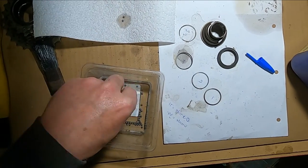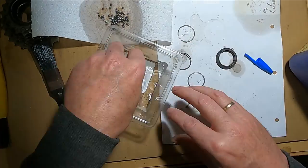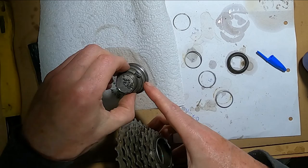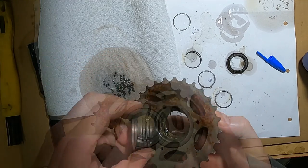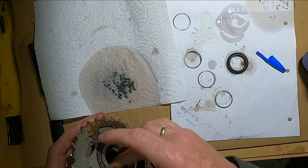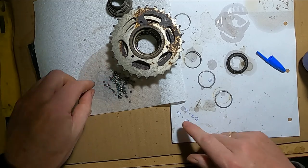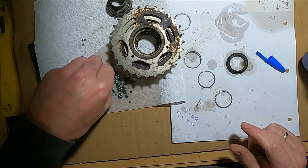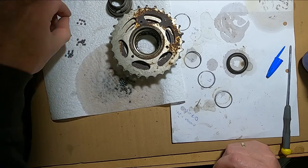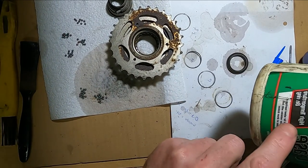Put all the bearings out on kitchen paper - a bit fiddly. Now to put the bearings back in, keep in mind that one lot of bearings goes in the outer race - that's the 39 - sitting in between those two. The other ones, the 31, go down in the inner race. I'll carefully put a little bit of grease around the inside and count out 31. Actually the inside takes 39.